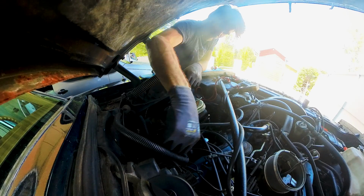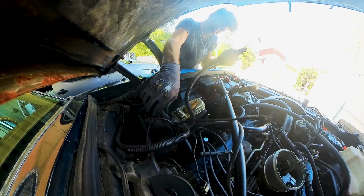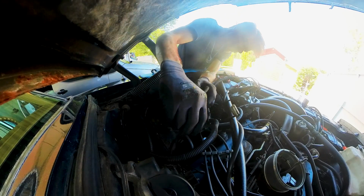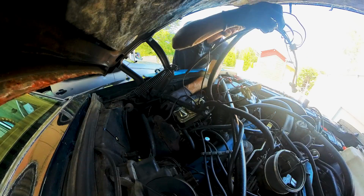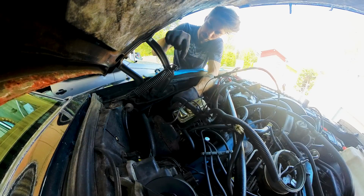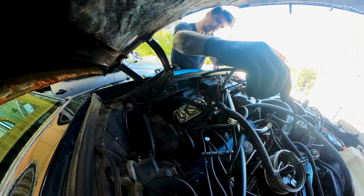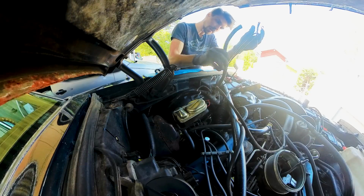Straight up into this wiring loom. You see? Maybe I can get this off here. All right. Except for one wire, which is, where is it? Here. Except for this brown wire from my starter, which runs up to this junction block, every other wire runs to the bulkhead connector, connecting to the fuse block. Let's open this wiring loom here and see where this wire is faulty.